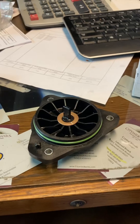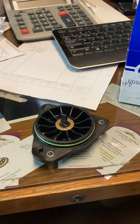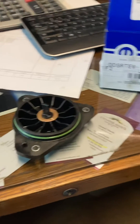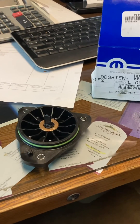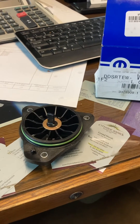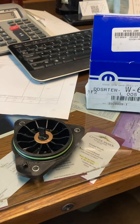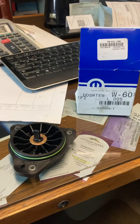This is probably not the only thing that's wrong with that transfer case. There's a drum in there that wears about 20 thousandths out of it, and then it starts throwing codes. We've also had to replace the module on the last one we did — we had to replace everything in it. You need to use factory parts for this because the aftermarket ones last about three months.